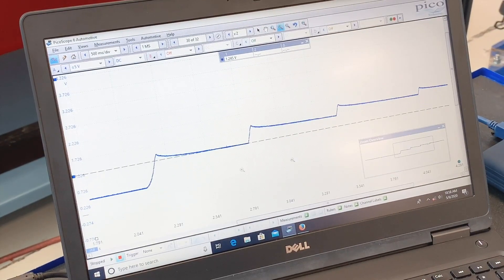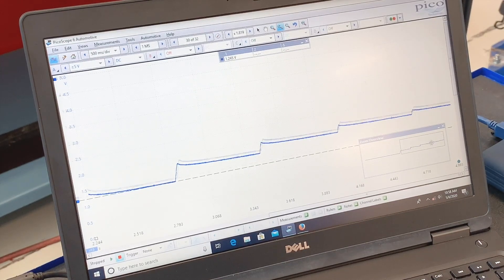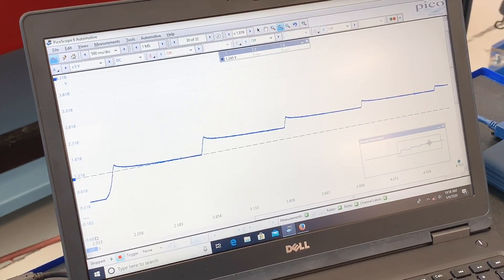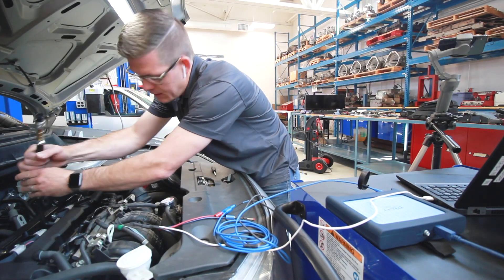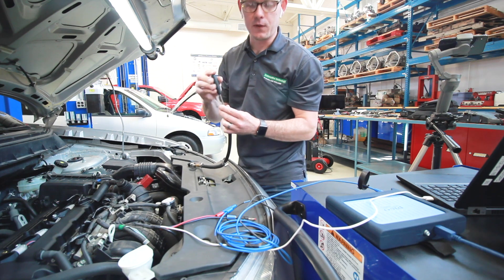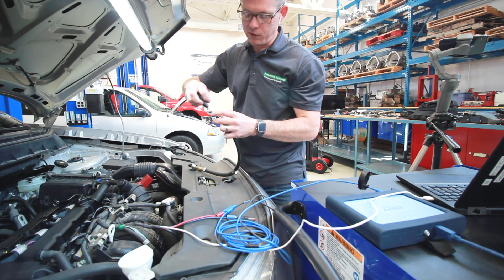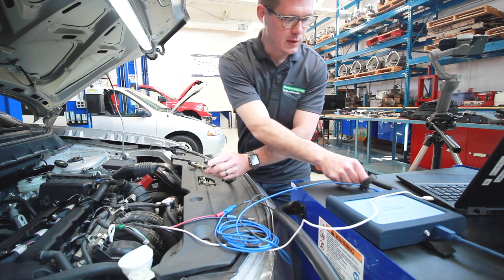Let's zoom in a little bit — looks like we got some readings. I left my ruler from where we calibrated to 100 psi, and on the first pulse I hit 100 and then climbed again and again. Interestingly, this looks very much like an analog gauge compression test — just kind of peaks as I go through. I'm realizing my mistake is that I've got a Schrader valve in there, and that's going to keep pressure building across multiple pulses. So we'll take that out and try it again, because I don't want that pressure to stay and build within this hose.